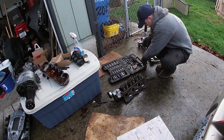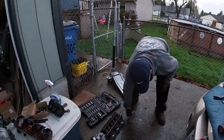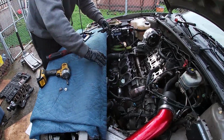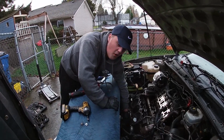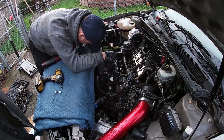You shouldn't put the cylinder head you're going to be using on concrete. It's on the head gasket, Davis. It's on a head gasket? Yeah, it's fine. After I tell him this, he still doesn't do anything. It's fine. Your second motor is going to blow up now. Why? Because the head is not sitting on the seal. It's going to get water in the engine. It's going to do the same thing. The new engine? Well, no, that head. It's already got a bunch of water in it.